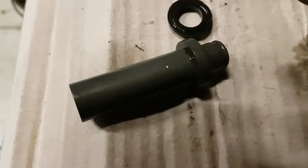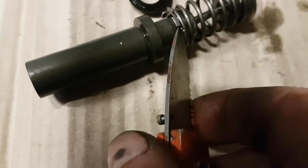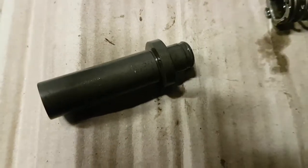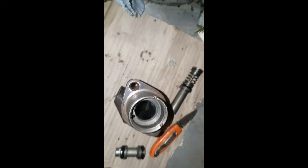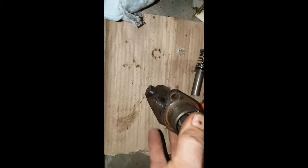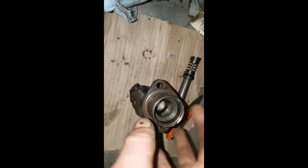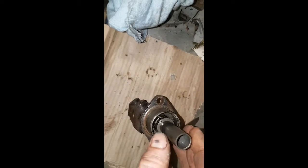What I've found — see that there — you can prise that off with a blade, levering it up. It makes it easier to get the seal on. And then the seal goes on like that, then you just push that back over. Got to put the spring back in first. Now clean that out, put the new seals on there — that goes up that way. Put the new seals on there, like so.